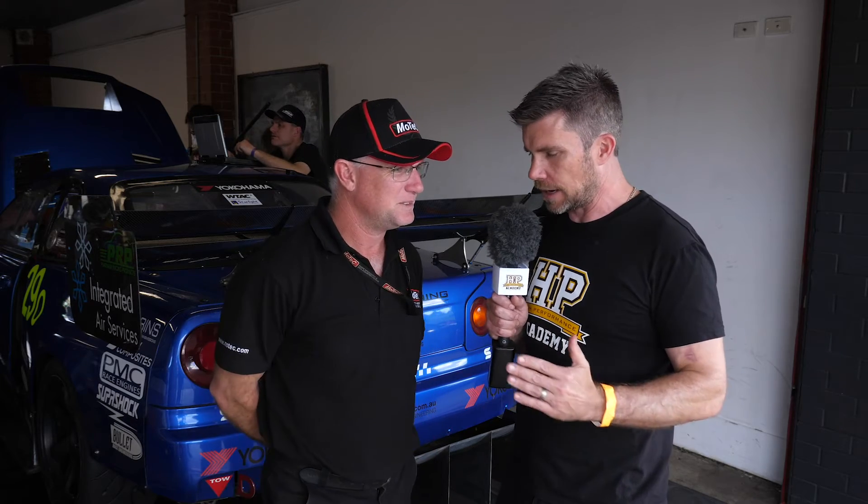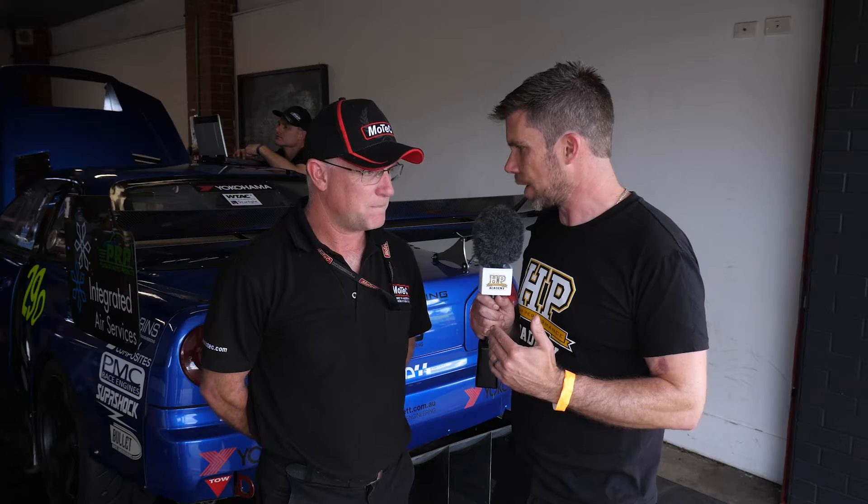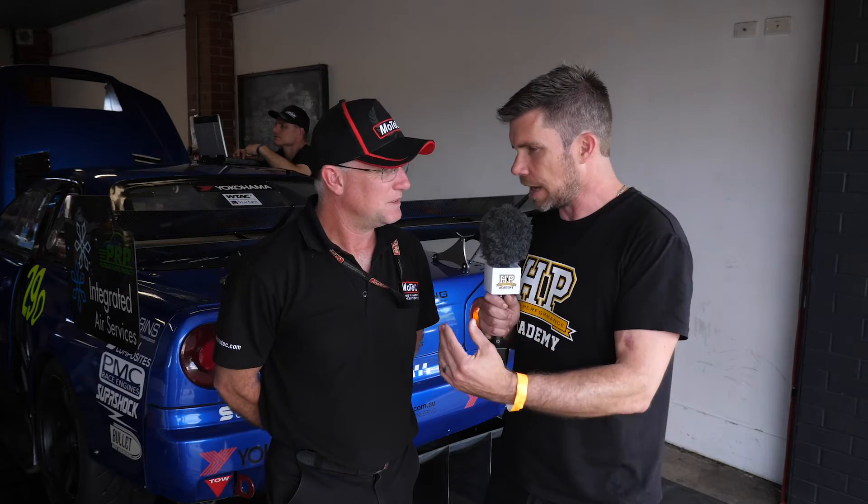Let's just stop because there's a lot of information to unpack there. For those who aren't familiar with the GTR transmission in this model car, essentially when you've got zero pressure on that clutch pack, it basically becomes a rear wheel drive car. So what you're talking about is as you're adding pressure into that clutch pack, it's adding more and more torque transfer to the front.